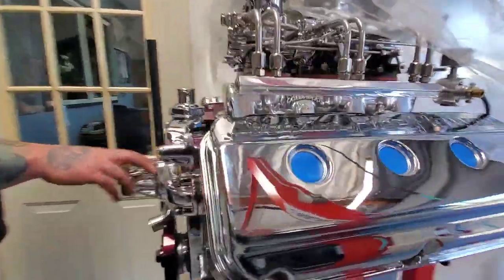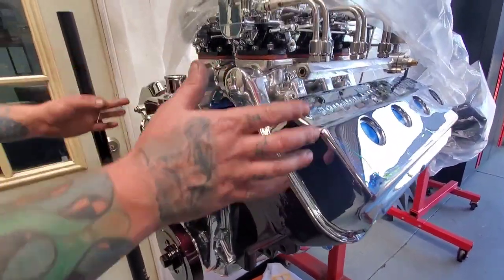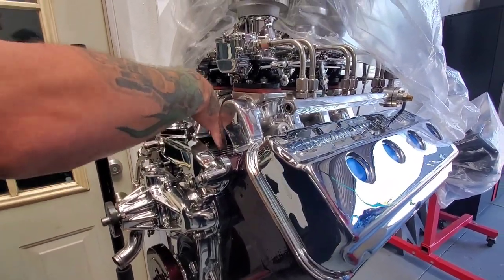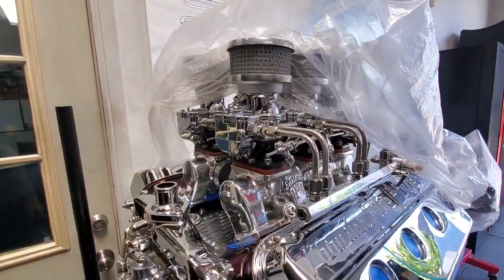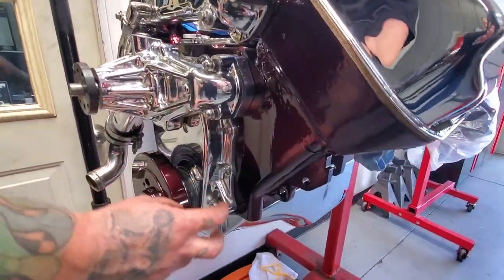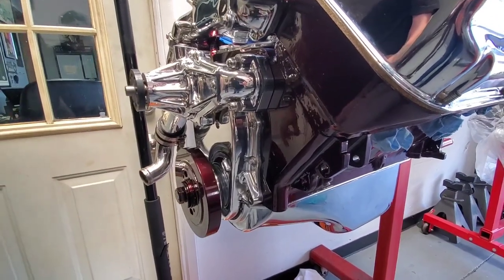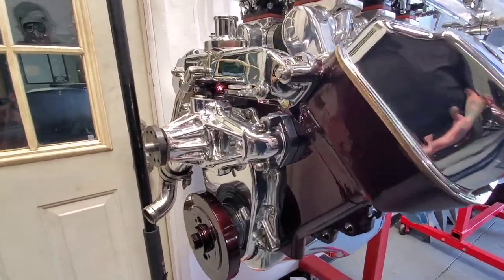This is a GM water pump with special adapters for it because we have a Mopar engine. We make the lines and change some stuff. Special valley pan. And we have bleeders for the PCV valve, different. It's all custom. We have a special timing cover for the fuel pump. That means we have an electric pump, and it's nice and smooth without a bracket or anything.